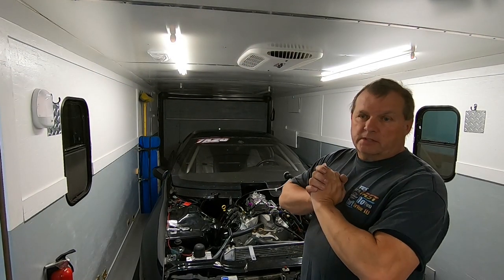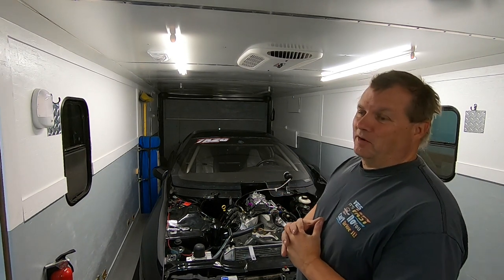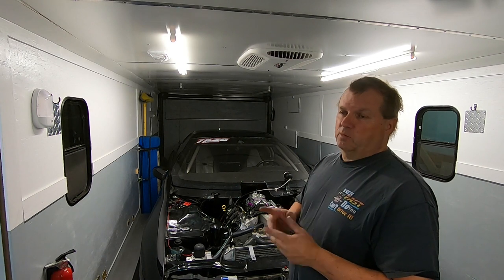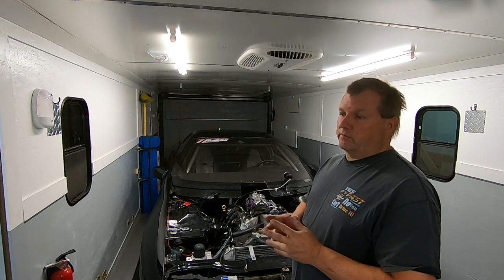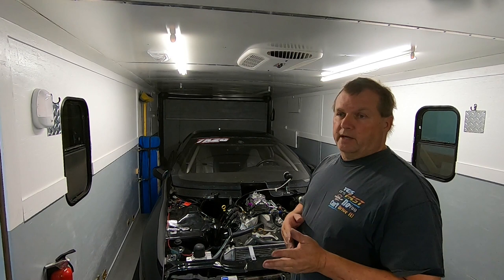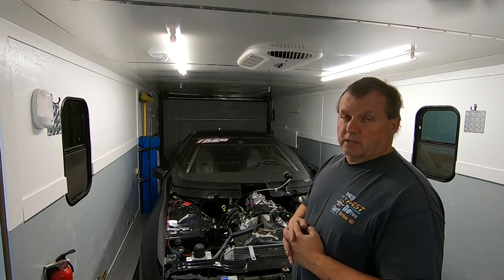Hey guys, let me get you up to date with the gas car. You probably already know this, but gas is slower — quite a bit slower. I threw a lot at it: my best guess on the timing and best guess on the jets and all that stuff. I think the best for the jets was 72 and 82 — that's the best time it ran with those jets. If I went higher or lower it slowed down either way. Timing we had it from 30 to 34 degrees. That's all the time I had — only had four passes to try to get this — but I don't think even changing timing or the jets too much more is going to make it that much quicker.